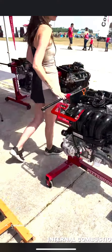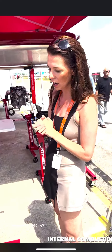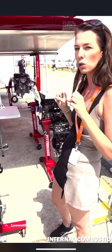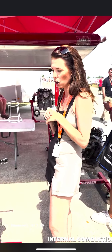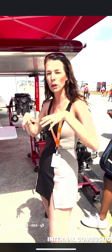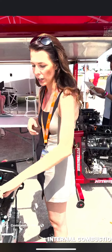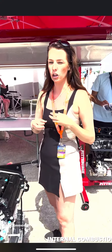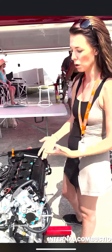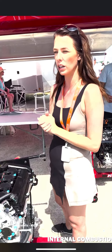This one here is our 130 horsepower — a 1.5 liter Honda Fit engine. It's direct-injected, whereas the 150 is port-injected. One of the benefits is that fuel sprays directly onto the cylinders, and we get all the benefits in the airplane that you don't necessarily get in the car. Some people are worried about carbon buildup in direct-injected engines, but due to EPA standards — just like you would do in your Continental or Lycoming — it goes overboard, so we don't have those carbon buildup issues. We get really good efficiency and power out of the engine. This is one of our most popular models, and it's on display over at the Zenith booth in my personal Zenith 650 that we flew over.